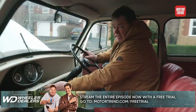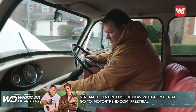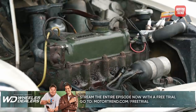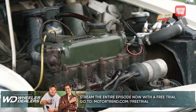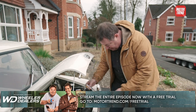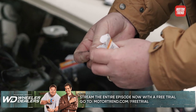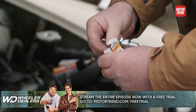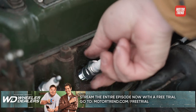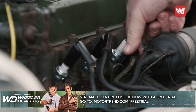Remember, there's no plugs in the engine, so it's not going to fire into life. That's all you need to do — little taps of the key. That seems like it's moving freely to me. I'm going to be using these new plugs. You would normally gap the plugs to make sure that the gap is correct, but I'm just going to go with the factory setting, which should be good enough. Screw them in. Pop the HT leads back on.